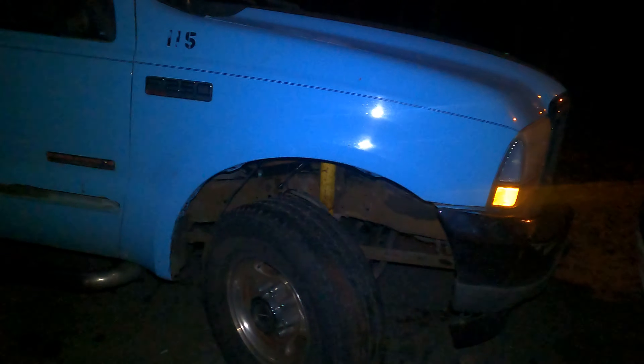Back from the auto parts store. What we know now: we can jump straight to the starter and it doesn't spin over the engine, so the engine isn't spinning even though the starter is good. That also bypasses the fuses, so fuses are not the issue. Additionally, we had all the glow plugs out of the passenger side, showing that the passenger side is not causing the hydrolock — if the truck is hydrolocked at all.